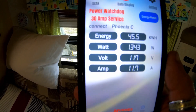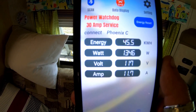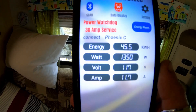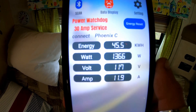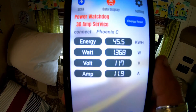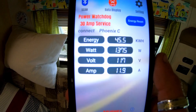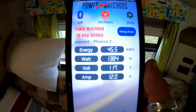When the compressor kicked in, we saw 1305, 1328, 1381 watts — that's about 1300 watts with the compressor kicking in and running. That is a big difference — it doesn't have that hard kick like it normally would. With the Micro Air, it's around 1372 watts, and a small generator will run that. We've got to do this two more times.